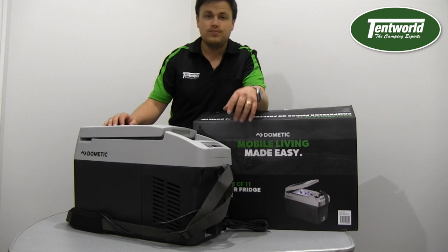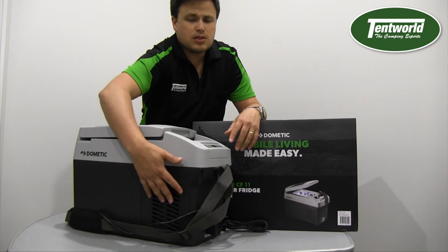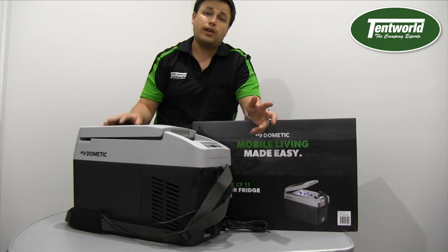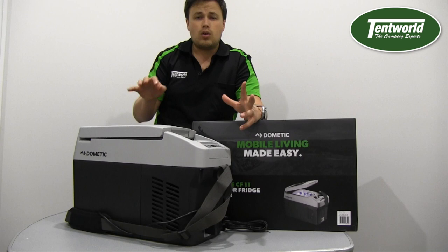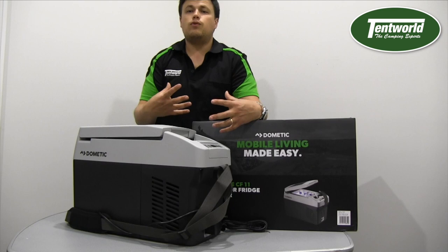So there you have it — that's the CF-11. If you're after a small, powerful little fridge, this is it. The compressor is disproportionately large for the volume of space it looks after. I've spoken to customers who say they've put as many drinks in there as they can and they're cold within half an hour — that's really great performance. Remember, whenever you're using a fridge like this, always use it full. This fridge doesn't have an internal fan to push air around, so keeping it full makes it run really efficiently. That's really important to remember with all portable refrigeration.